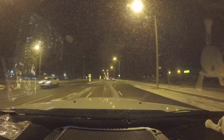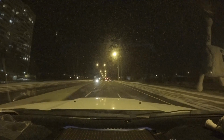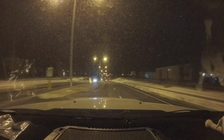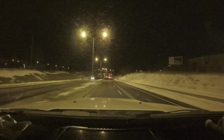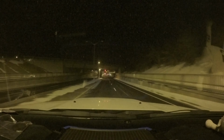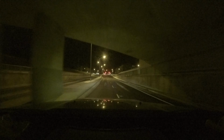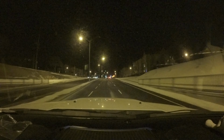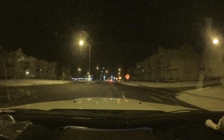Now for myself, as from previous videos, if you watched any of them, I would like something that is going to last a very long time with my vehicles. I tend to go for simplistic designs, such as this truck. It has a very simple engine, a very simple transmission, and the transfer case is basically bulletproof if you don't misuse it. The only thing I can do to abuse this transfer case is basically leave it in four-wheel drive lock, such as right now on dry pavement, and that will definitely put a large strain on the powertrain.